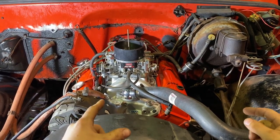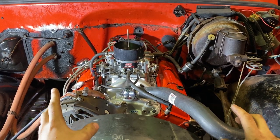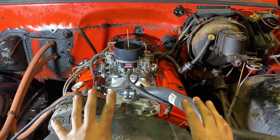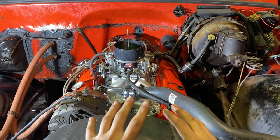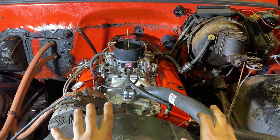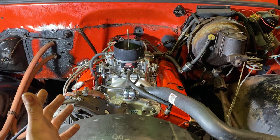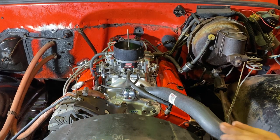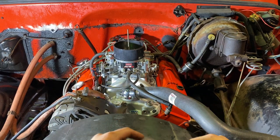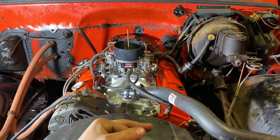So I've decided to give them a half a turn on each rocker arm. They've already been adjusted, so it doesn't matter where the motor is right now. I'm going to give every single one of them a half turn — that should put the plungers in a different position — and then I'm going to run it from there. Whatever happens, happens, unless it gets really bad and I decide I'm going to change the lifters and make a bunch of extra work for myself.